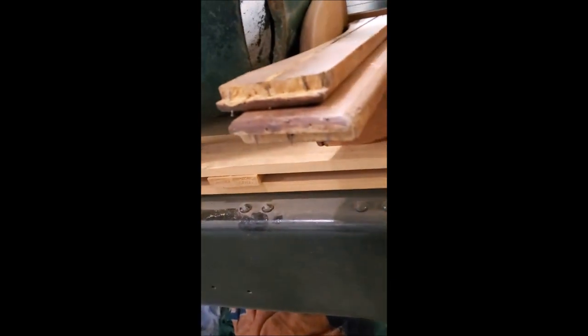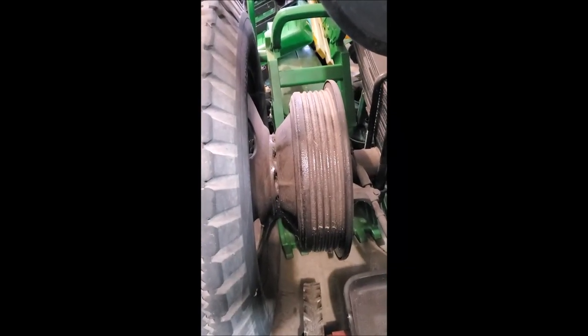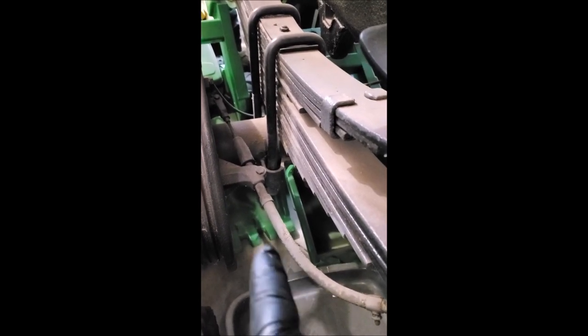As of right now, you can't see it because it's been in the garage and everything's so dusty, but the rear end, from the rear of the frame all the way up to right here by the running boards, as you can see how it gets rusty. This back here has all been wire wheeled, primed, painted, undercoated on the inside, and painted. The drive shaft has been done. All the brake shoes were actually really in good shape. The wheel cylinders were shot, those are replaced. These right here are brand new emergency brake cables. Those were all shot and rusted off and replaced.